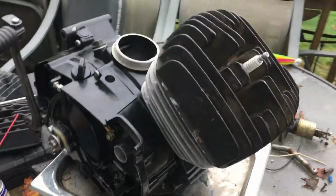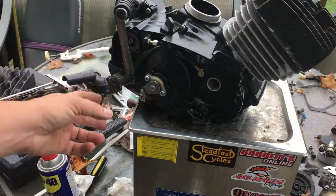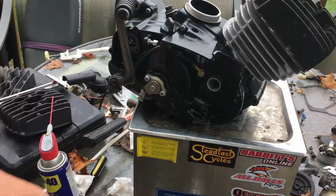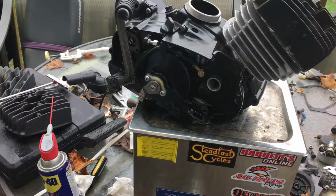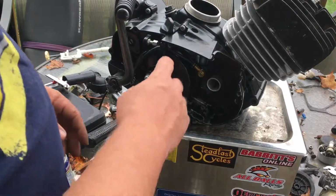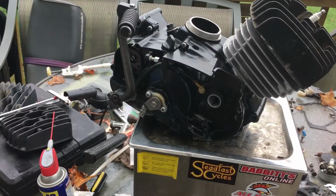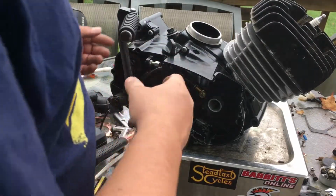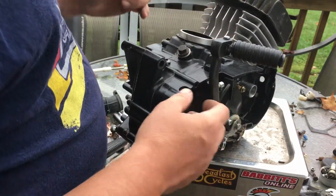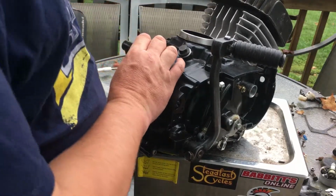I still have on this side right here, I got carburetor to do, oiler to do. We're going to order a brand new oiler for this thing, just because I'm not messing around with it. I've got the grommets, I got all that. Instead of having screws, we're going to do Allen head bolts. And I'm going to show you how to, it's kind of like never seize, but we're using candle wax on stainless bolts. I'll show you that trick. You're going to like that one.